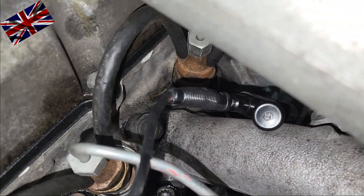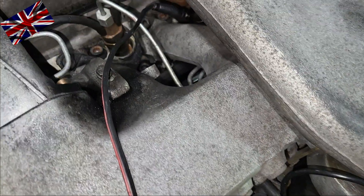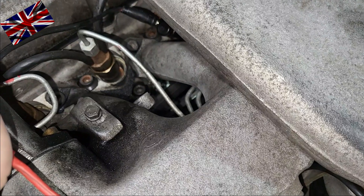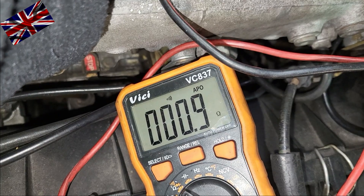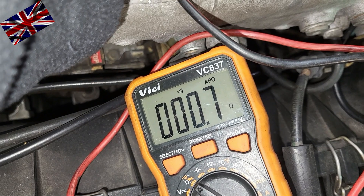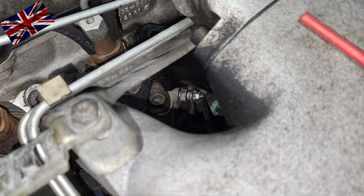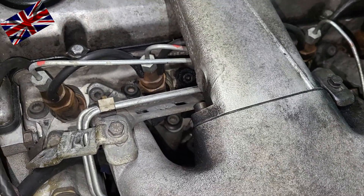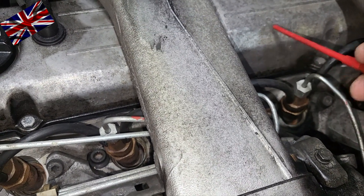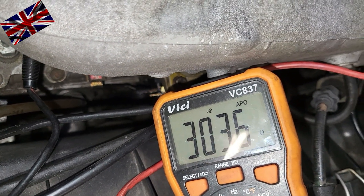This black handle is the upper end of my plus tip being connected to one plug. The multimeter is set to ohm, which is resistance. Now place your minus tip to mass - hear that noise? Beep - seems to be okay. It is the one closest to the firewall. Now let me check the other one - to the penultimate glow plug being checked. No noise, no beep, no resistance - multimeter shows wild numbers. Second plug is shot for sure.